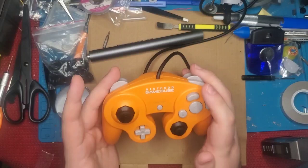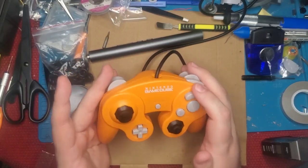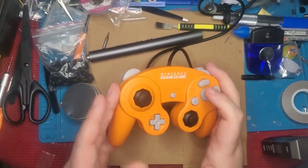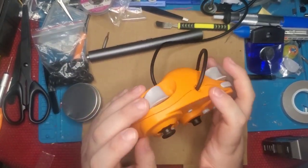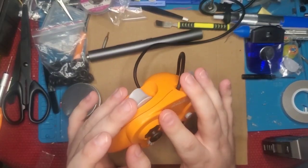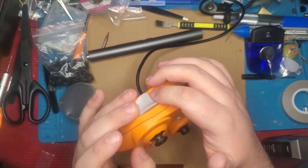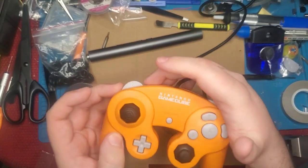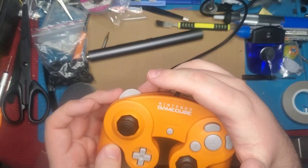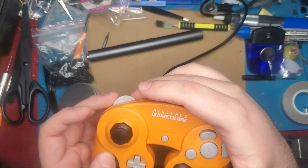And now how do we make that so that it's a more reliable actuation? There's two problems to confront here. Problem number one is the fact that the L&R triggers don't quite mount perfectly into the shell, which allows for a bit of rotation. If you can see this from top, I'm rotating the actual piece inside the shell. It's going to the side, it's not depressing.